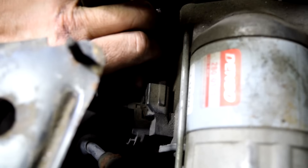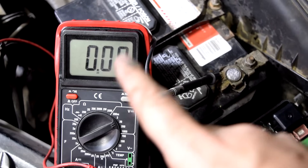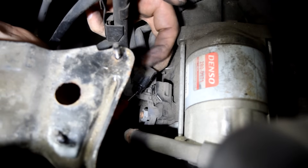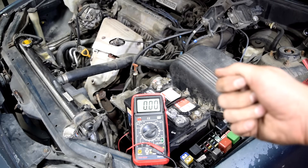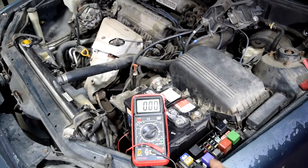Next it's time to see whether we are getting 12 volts supplied to this trigger post when we turn the key to the crank position. First we'll remove this connector, then grab our multimeter, keep it on the voltage setting, and ground our black test lead. We attach our other test lead to this connector — or you can back-probe the connector if it's easier. Then we get in our car, turn our ignition switch all the way to the crank position, and we should have 12 volts here. Make sure you put that relay back in the fuse box if you took it out to test it.